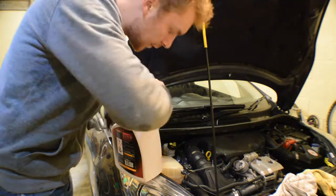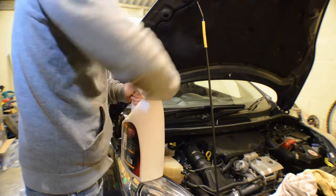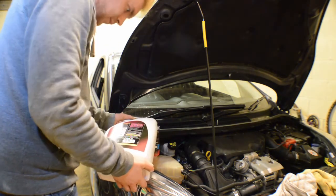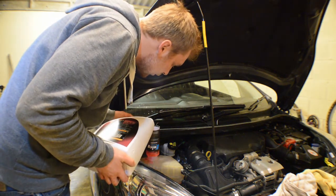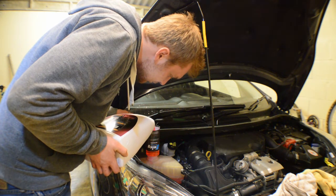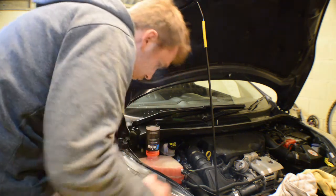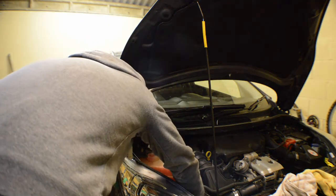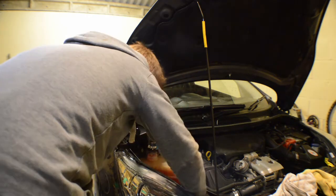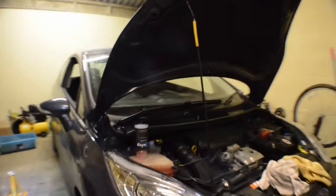Let's open up this bottle. Yeah, this takes 5.8 litres, so this is a 5 litre bottle, so I'm going to try and empty as much as I can of this in there. And pump the pipes about a bit. If this will come off, there we go. Right, let's see how much mess we make. Radiator pipe. Yep. Right. Barely got half of that in there before it filled up.